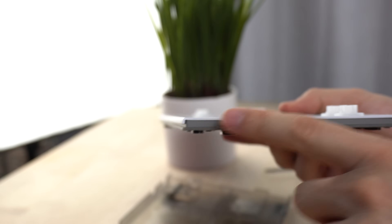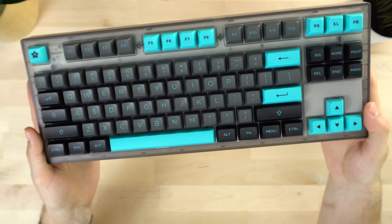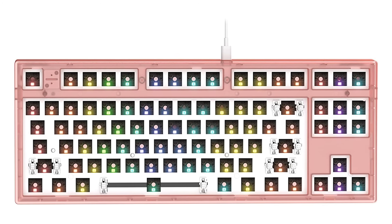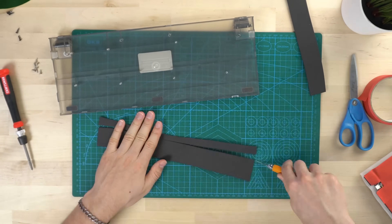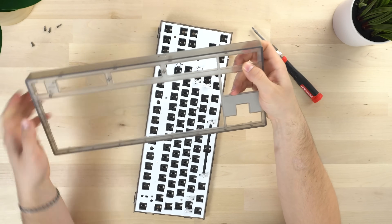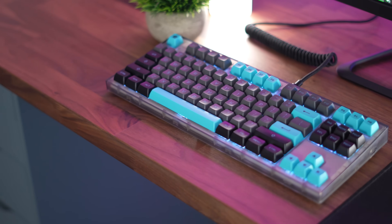You get screw-in stabs and south-facing LEDs. Now for the plate, it is a quite rigid metal plate. However, I've heard you can get polycarbonate plates and brass plates separately for this. For the color, you can get it in this translucent smoky black or in translucent pink. For mounting, this does use standoffs, but they're not super intrusive and there aren't a lot of them. This is also a two-piece plastic case — the easiest case to get apart on the list, and it's really solid when it's together. For dampening, there's no dampening in the case, but there is silicone between the plate and the PCB, which is absolutely fantastic — great dampening that you really can't replicate yourself. They include it if you want a ton of dampening.